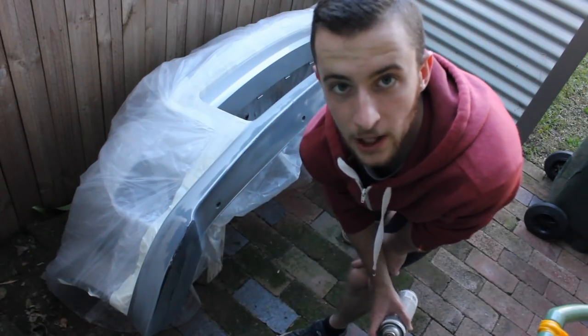Because I'm trying to get a straight line with plasti-dip — now usually this is very hard to do. When you let it dry and then try to peel the tape away it actually tears the plasti-dip. So I've taped it all up and pretty much we have to do it very quickly — I've got to do one heavy coat that's even over the whole area and then just rip the tape off straight away and let it dry like that. That's the only way to get a straight line with plasti-dip without having to get a knife and cut it. All right guys, wish me luck.